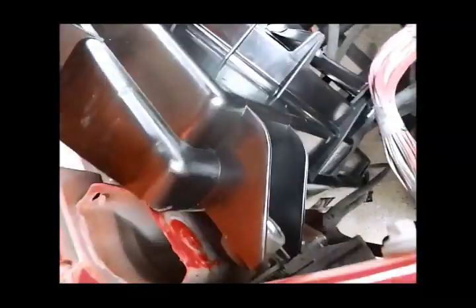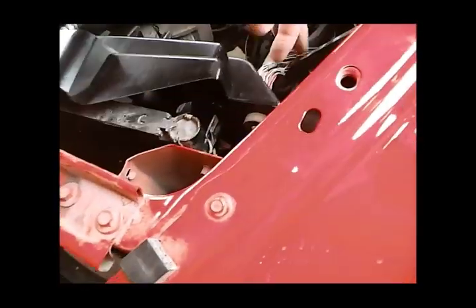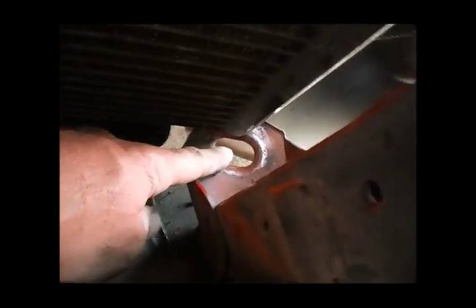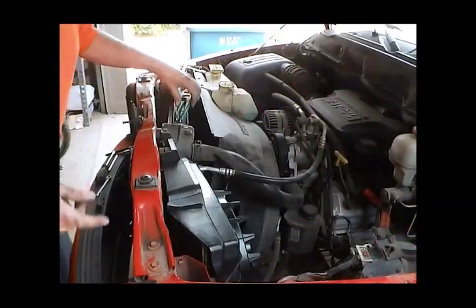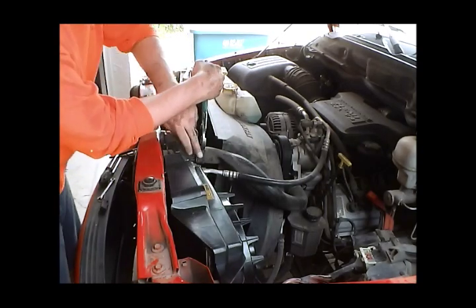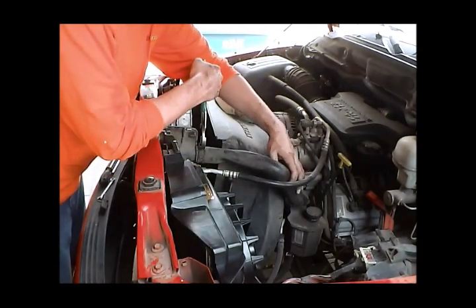I'm going to go ahead and put this stuff back together. At this point you're going to want to attach your condenser — because the condenser is easily movable, line up your holes, put your bolts, two on each side. Then attach your condenser fan back to the radiator support up front. At the bottom where those bushings are, there are two guide holes, one on each side — put those in first and then sort of bring it forward. One thing I did have to do: the radiator hose was really in the way down here, so I crimped the hose clamp and twisted the hose so it was up out of the way. Just make sure it's a good hose — feel it, make sure it's not making crackling noises or you might rip it.